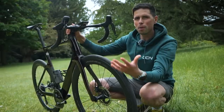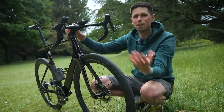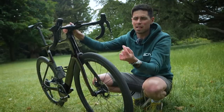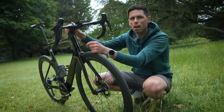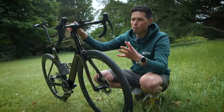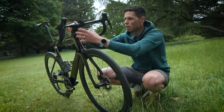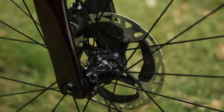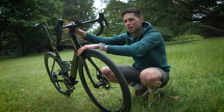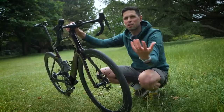If your bike uses mechanical shifting, the cables running to the front and rear derailleur can be lubricated to help them last longer. With externally routed cables, a little spray of maintenance spray or a drop of oil into the outer housing where the cable inner goes keeps everything running smoothly. With internally routed cables, I wouldn't bother taking everything apart just to lubricate — if you've got it apart, best to replace with new. For the brake caliper, whether rim or disc, the pivot points can be lubricated with chain lube or standard maintenance spray.